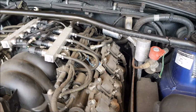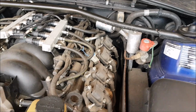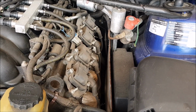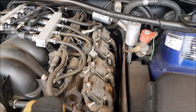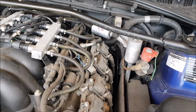And if that leak gets any worse, my point was, while doing the lifters, I might as well do the Welsh plugs, because that's where they are, right on the ends of the heads. So I was thinking, while the heads are out, do the Welsh plugs. I don't think the Welsh plugs are rusted out. It either wasn't fitted properly, or this motor did overheat at one stage. It seems a bit dirty water stained everywhere, and I reckon it might have put a bit of pressure on it and pushed it out a bit.